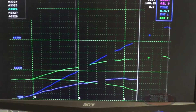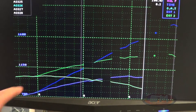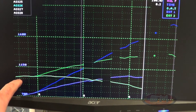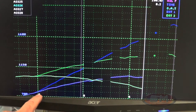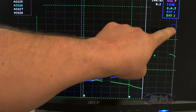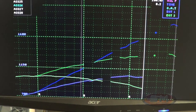Also wanted to show you the difference — kind of forgot — show you the comparison. This is what it was: it was supposed to have made 1,150 or 1,200 horsepower. On our dyno it only made 1,040, which is not uncommon. The blue line is horsepower, the green line is torque. We're actually about three pounds of boost less at 3,500 RPM, and about 40 foot-pounds of torque less as it went down. Horsepower is nearly identical and just crosses down below. This is the old 1471, this is the ProCharger — and that's our 1,818 horsepower up there versus 1,040 down here. It's kind of interesting just to see the linear power curve that you get with the centrifugals.